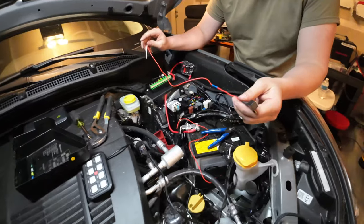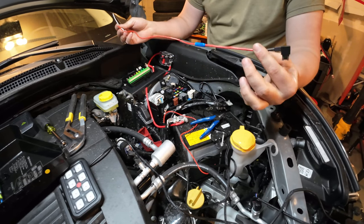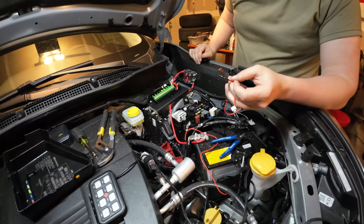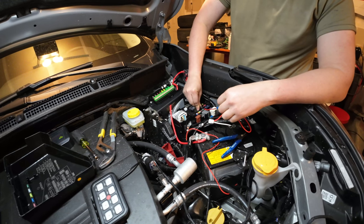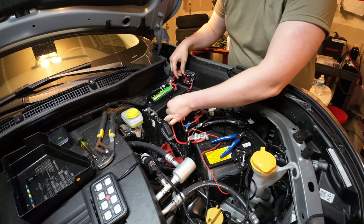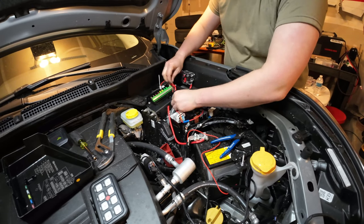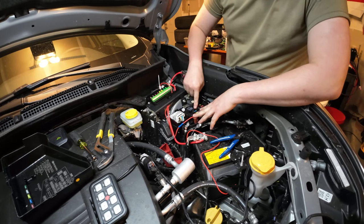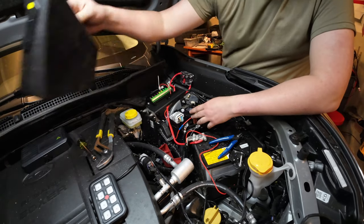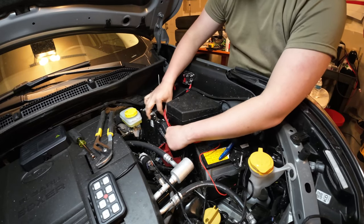The wire is cut appropriately — the white wire end is cut short since you just tap it to positive to cycle brightnesses. On the ignition side we connected a fuse tap, borrowing a 7.5-amp fuse from the spares on top of the cover. We'll replace it later. You can use just about any of the empty slots in the fuse box. Run the wire down through the opening in the fuse box, up through the dash, and it connects to the power panel. The important thing is use one of these empty switched slots — it should come on when you turn the ignition on.